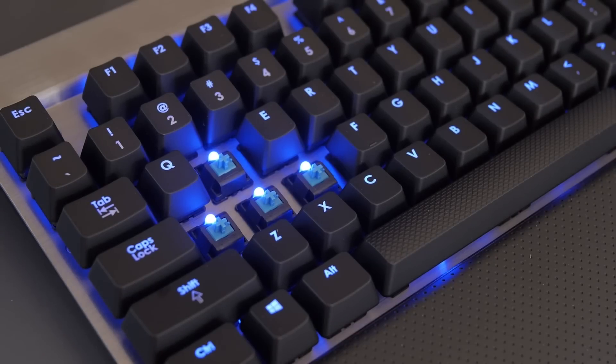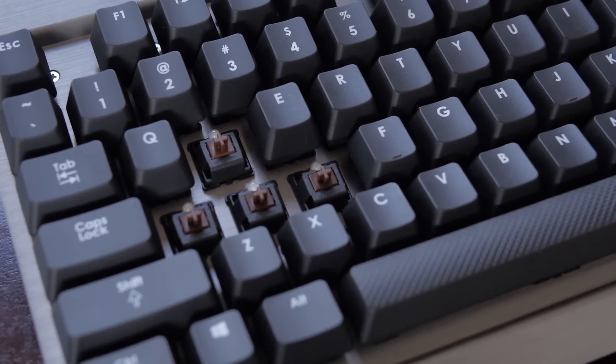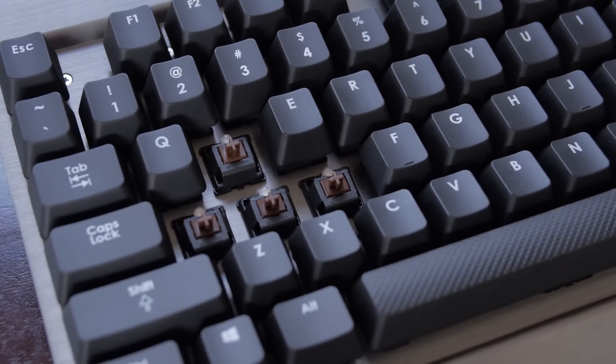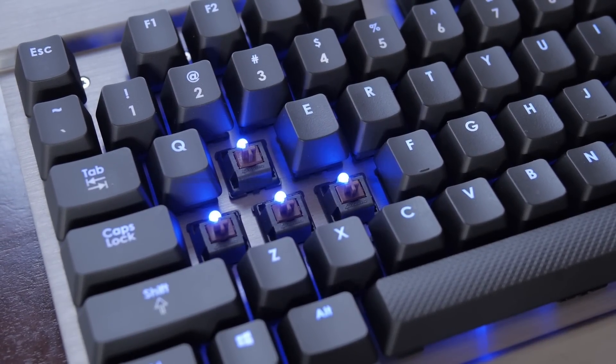The tactile switches. I'm going to mostly cover the ones from Corsair because we have a bunch of Corsair keyboards in the house — they did not sponsor this video. Let's start off with the Corsair Brown switches. The Brown switches are a tactile switch but they are not clicky. They're smooth and have a nice satisfying actuation point. It requires 45 grams of force to actuate, and if you push them all the way to the bottom it's 55 grams.